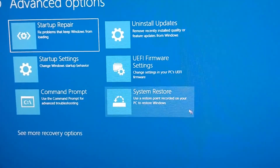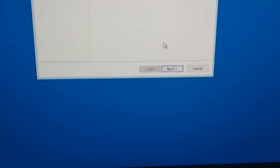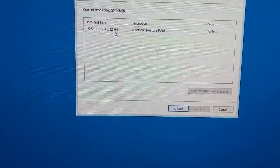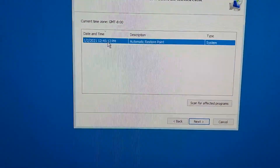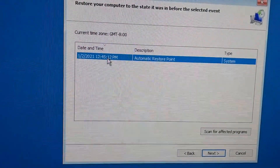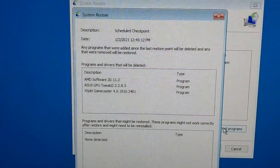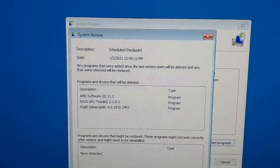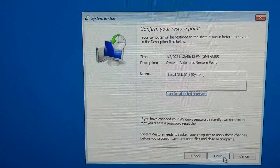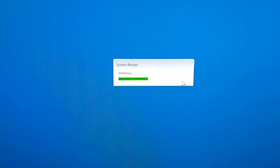Let's try System Restore and see what happens — I have a gut feeling it's something to do with software. I'll scan for affected programs — the affected programs are the AMD ones. I'm going to delete the software by doing a restore, and then hopefully reinstall the GPU software and try to get the correct settings, because it seemed really unstable — crashing Windows, and Minecraft was only getting 35 to 60 frames.